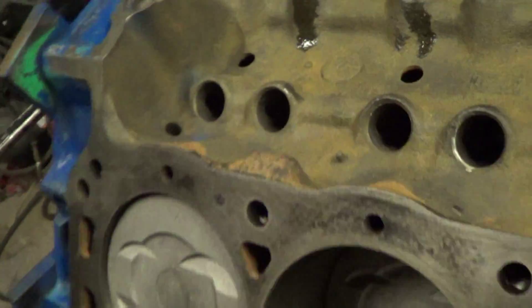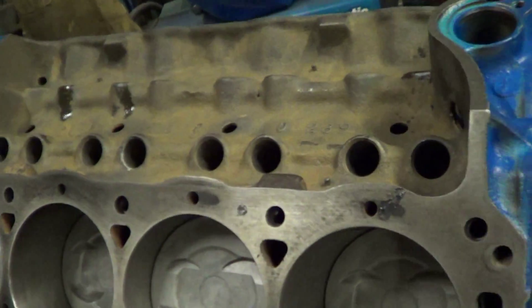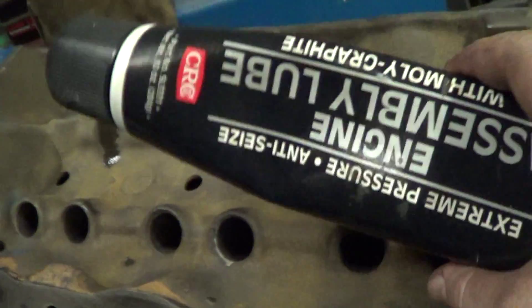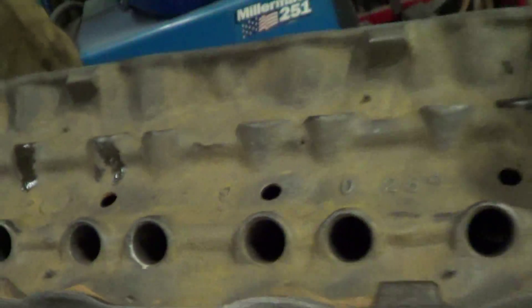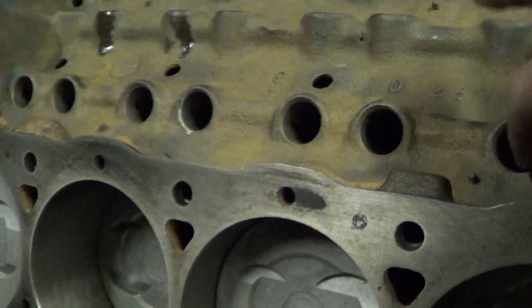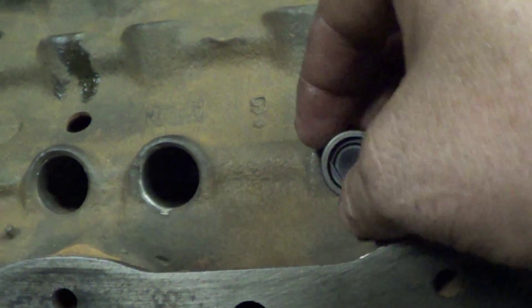Another thing I probably didn't get clued in on — I have a thing for a specific type of assembly lube. It's this stuff here, it's got moly graphite in it, it's a lithium base, just like a lot of stuff. But that white lithium stuff — the big problem with it was it was a major operation to get the lifters out of the engine because they were literally just glued in place.